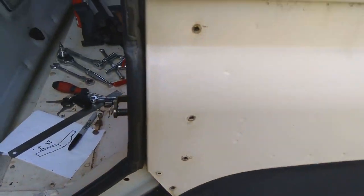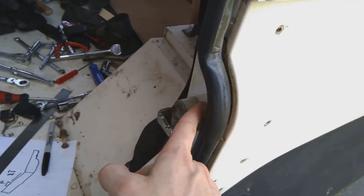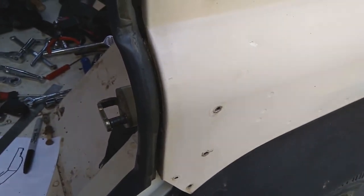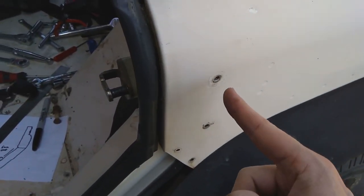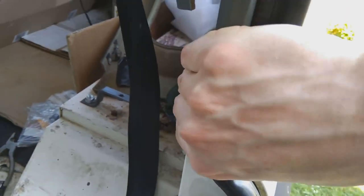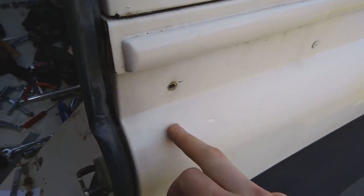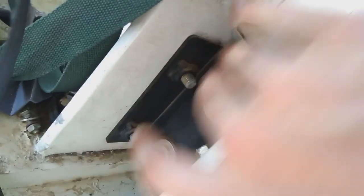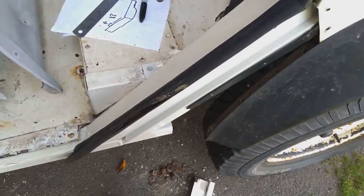Because what it's saying is that the body and the c-post are matched on the production line, because these aren't pre-drilled. So getting these holes to line up with the c-post, it's easier to probably just drill through this into the c-post. Also in the factory what they do is there's a big clamp that goes on here - they will clamp this together to drill those holes, which is probably what I need to do. And then this bit goes in a later step. In Puma models this is more of a single bracket that fits in here. Maybe it's a fixed alignment. So the upshot is that's annoying.